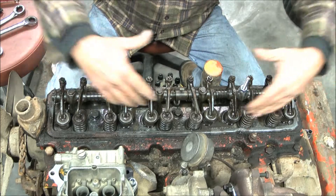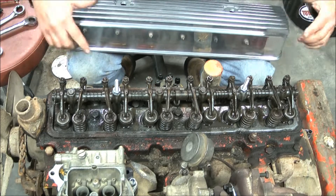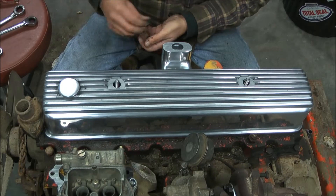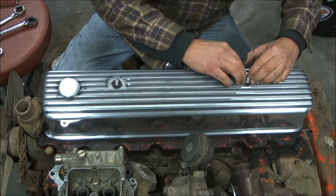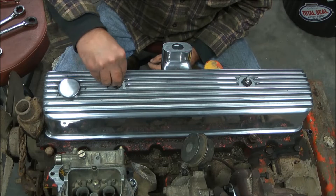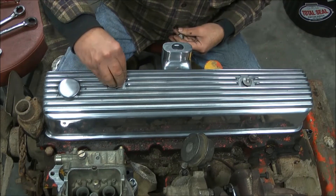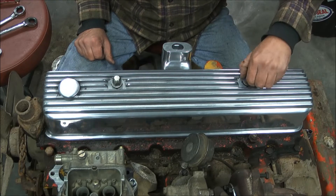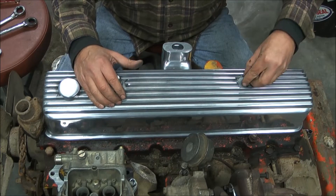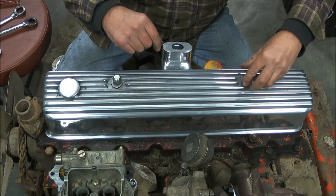So now we would place the gasket in there, then grab your valve cover that you're going to use — the seal is all in there — and simply lay the valve cover on. Isn't that pretty? The next thing is these rubber grommets that come with your gasket kit; they push into the valve cover, and they would do that on a stock valve cover also. Next step is the stainless steel sealing washer — it just adds a little pressure displacement on that seal to keep oil from coming out. And the next is your acorn nuts that are decorative. One thing to keep in mind: these acorn nuts are only threaded partway through, so they may bottom out before the valve cover gets tight. If that's the case, you either need to shorten the stud on the top side or add another washer.